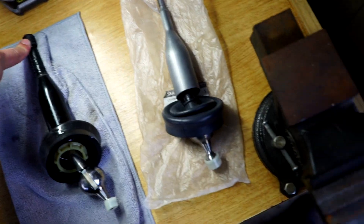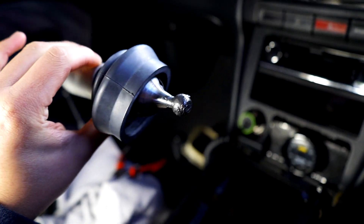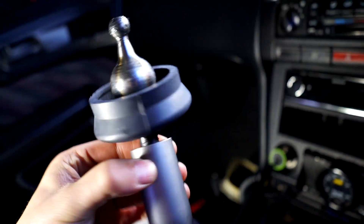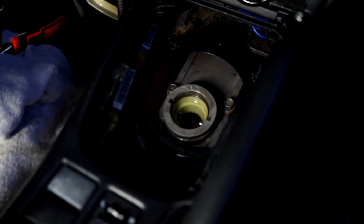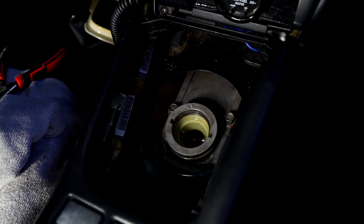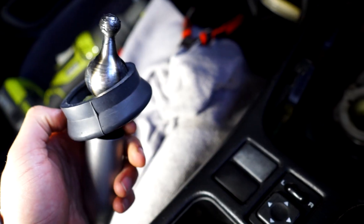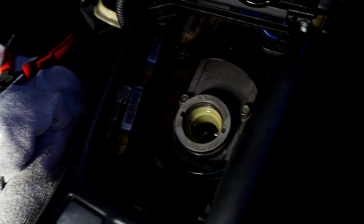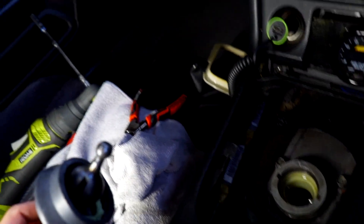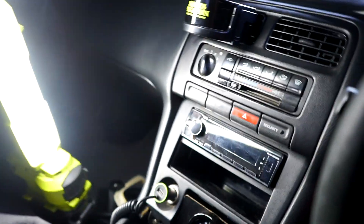We're going to rip this bushing off with pliers because we don't need it. I've put a little bit of molly lube on the end there just in case. If you wanted to fill your gearbox oil from here, this would be the best time to do it — I'm not going to, simply because I don't want gearbox oil in my interior. It's also a great time to give the top of this a clean just to spot any future leaks — you don't want it sealed to oil already. We'll chuck it in and get everything bolted up.